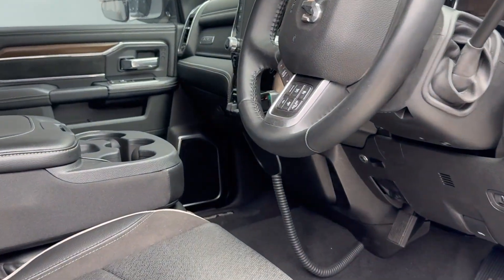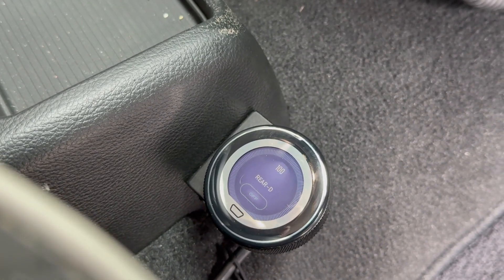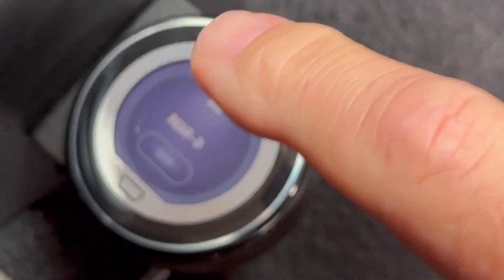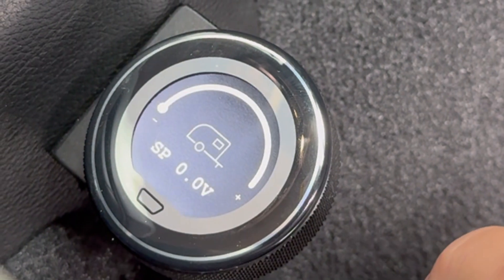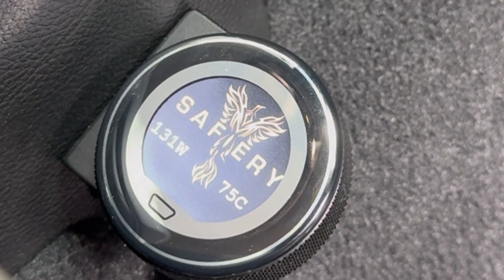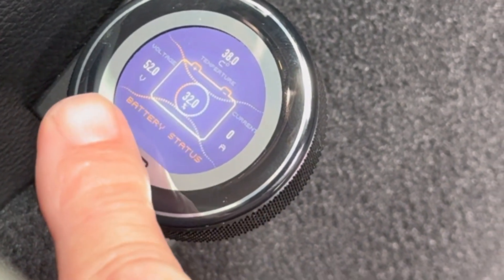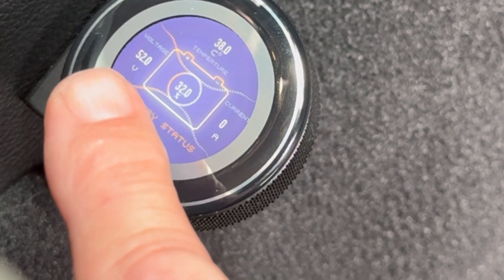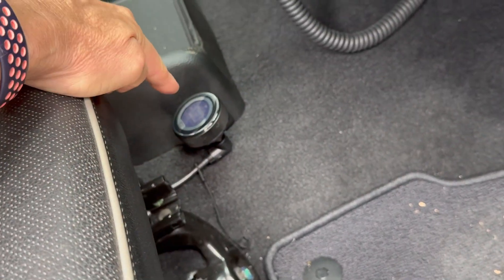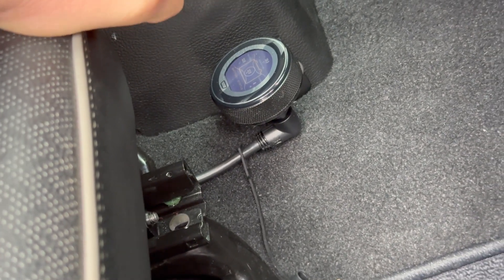While he's driving the car and inside the vehicle, we've got a third way of switching all the lights, which is on this display down here. You can see it's set there now for the rear driver side light at 100%. We can dim the lights down. But most importantly, we can see the whole battery system. If I swipe through on this, that's the actual voltage, that's the Scotty alternator. And now we can see the battery — the state of charge is 32%, 52 volts, and that's the battery temperature up there.